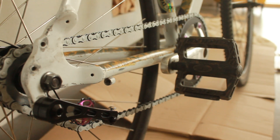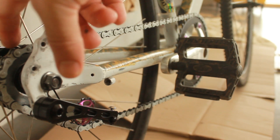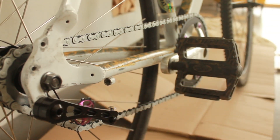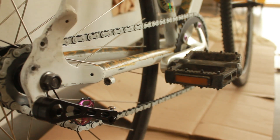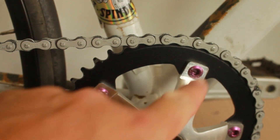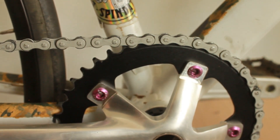Effectively, I've used the two sides of the track hub — specifically the side where I could get further out with the sprocket at the back. I've used a chain tensioner, and I had to buy a new crankset because the existing one wouldn't work — the chain line was too far out. What I've done is mounted the chain ring behind the cranks to give me a better chain line.